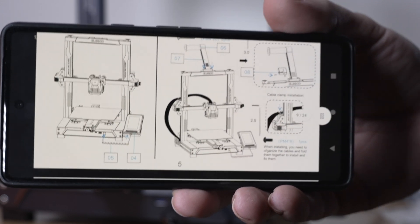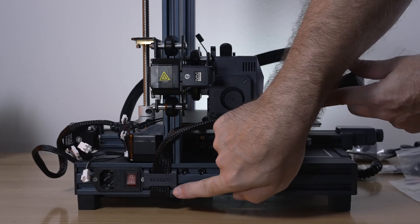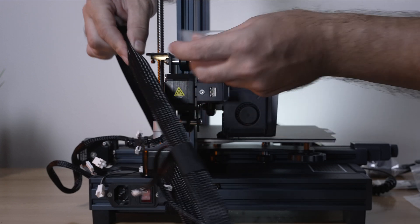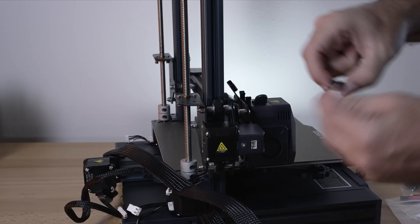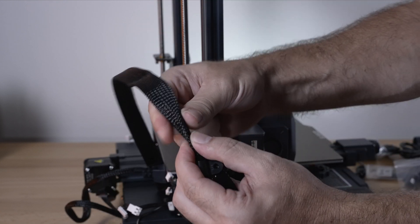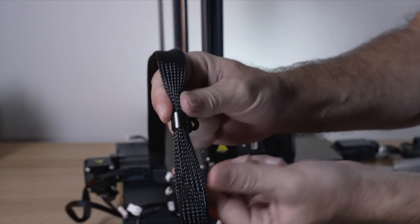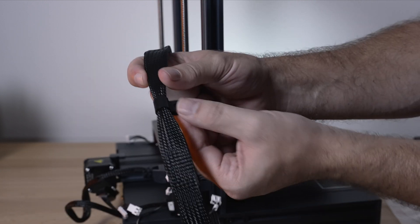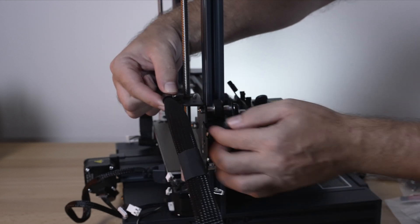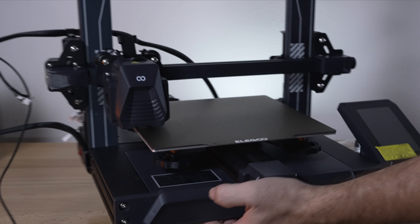Before going up, let's install the bracket that holds the cable running up the side. There's a split of wires, and we install this bracket next to the lead screw. The clip goes around the flat wire — if you push on it, it kind of becomes like a circle, which is where the bracket sits. You can fold or bounce it until it forms a perfect circle and fits right in. It can slide back and forth, and once positioned you connect it at the top and snug it down with the bolt.